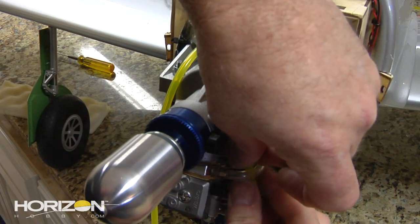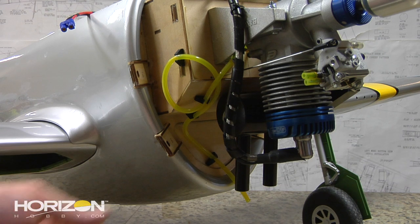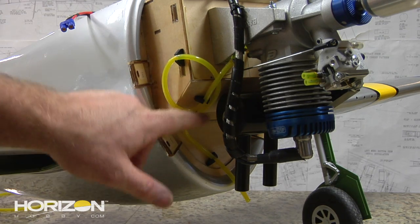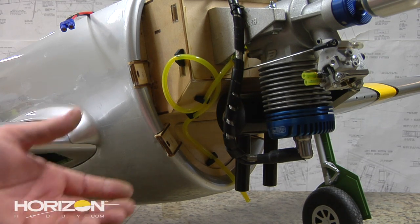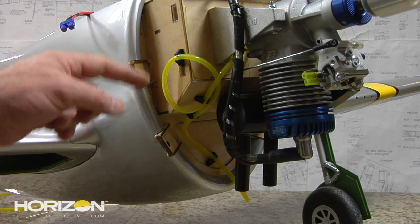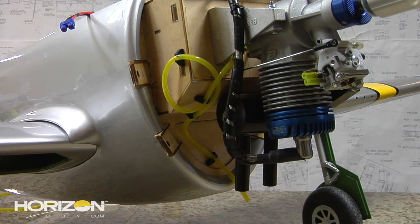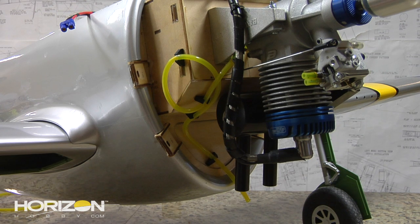I'm going to come over the top of the pressure line. We've got the fuel lines all run - the feed line is already hooked up to the carburetor and safety wired. Here you're going to see a loop in the drain line. The reason for this loop is it will eliminate the massive amount of fuel that will pop in and out of the tank as you do rolling maneuvers. This loop helps stop the siphoning of fuel during that - a very big thing with the aerobatic guys and the warbird guys. This is something you definitely want to do and it helps in fuel tank performance.